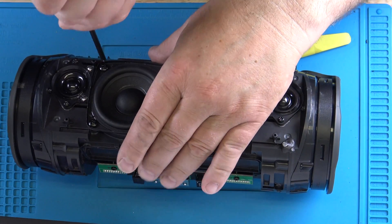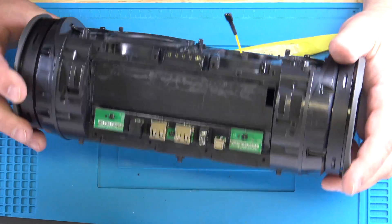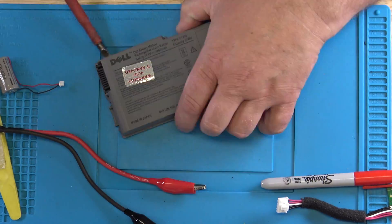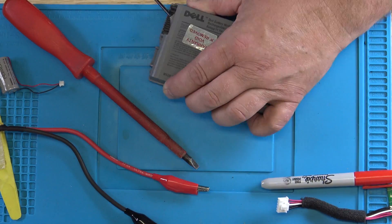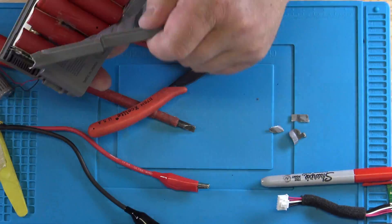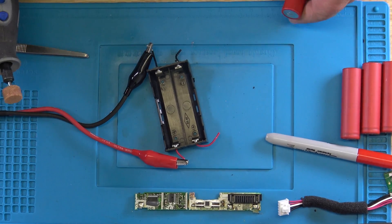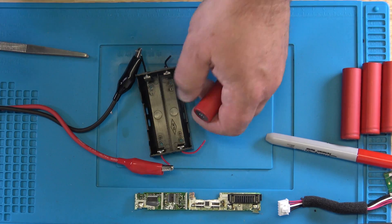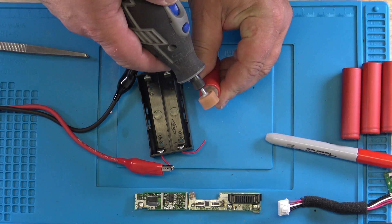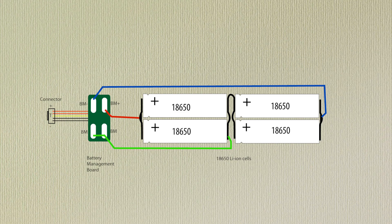The question is: where do you get those batteries from? I wanted to save money, so I took an old laptop battery and took out all the batteries from it. There were six in there. I cut those batteries out and measured every single one — there were four good ones and two bad ones. The whole battery pack went dead because two had zeroed out; they were shorted out.